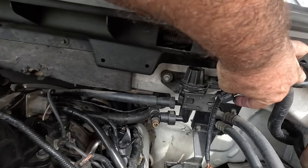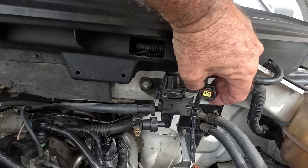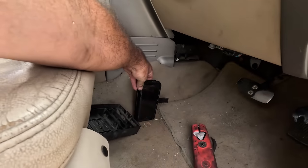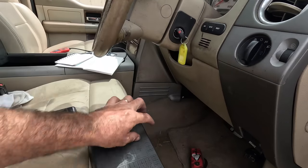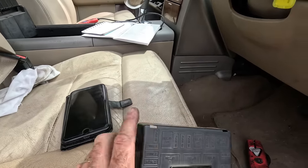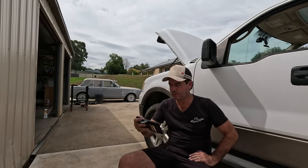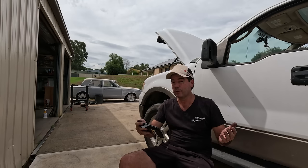but I tested in there for power whilst it was running, and it should be powered up, and there was nothing. And so I went to my old friend Google, and I Googled which fuse was going to be the correct one, and it's way up here, number 32. Let me just read you what it controls. Vapor management valve, which is that guy. Canister vent, AC clutch relay.